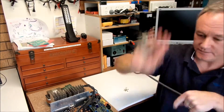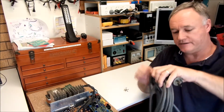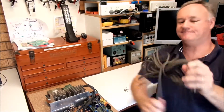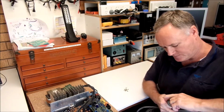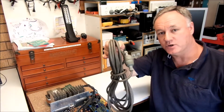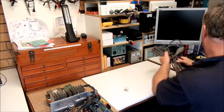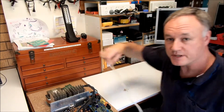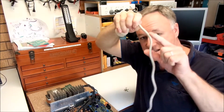A lot of people, especially tradies, like to do up their extension cords this way. Finally, they get this part, wind it right around, plug it back into itself. Now while that's handy to hang on a hook, what you're doing is damaging this. No, no, no. Reason being is you can end up with a problem like that. Look at the twist on that thing. That is damaging the copper inside, so don't do it.